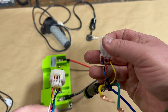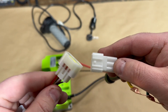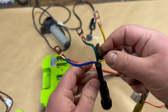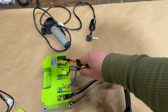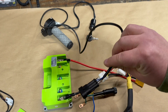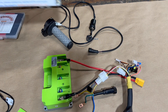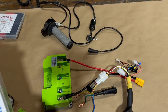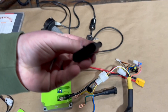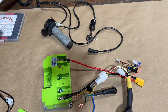I've already wired this up and the pins just go color to color. This one's missing one because the Far Driver can do a temp sensor on the motor and the Burromax does not. I wired these up so this is now plug and play. Then you take your three phase wires, put them on the controller, and the only other thing you need is a throttle and a key. We have these plugs on our website — it's a plug kit off Amazon. You use a crimping tool to crimp those, and male and female spade plugs to connect up your wiring harness. Pretty simple, just a little tedious.